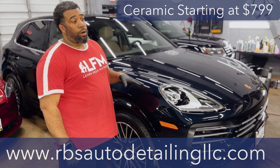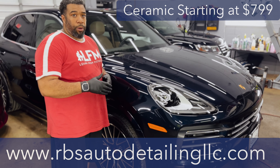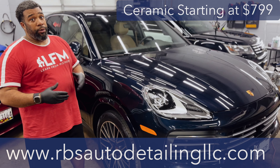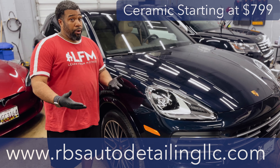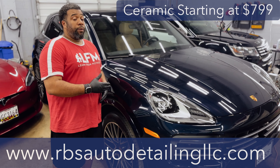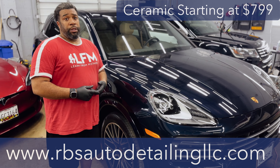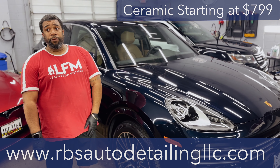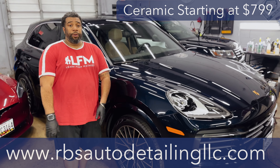We had to go back and do a lot to this car. We're not fully finished, but we're almost there. We just got it to the buffing process. We're about to lay the ceramic on it — believe it or not, as good as it probably looks. But removing all the imperfections on this was hectic: water spots, dealing with different paints, different mils of paint. You've got to be careful because when you buff different surfaces, you do not want to burn the paint.